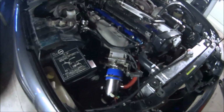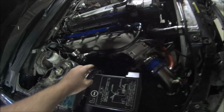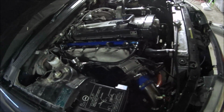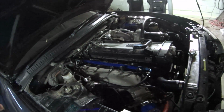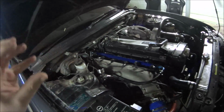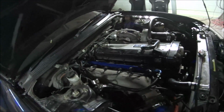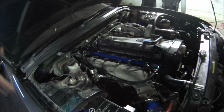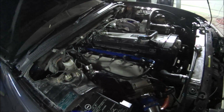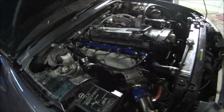I can't remember if I said this last night or not. I put the oil filter in, the new one. I put as much oil in it as I could and still hold it just past horizontal. It's got some in it as part of the oil system, so it doesn't spend all day trying to fill that up while I'm trying to start it, and starve it of oil. Obviously plug one in, I'll put the oil in it.